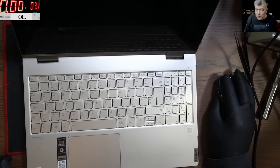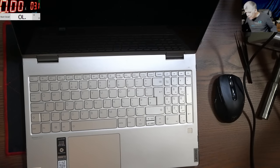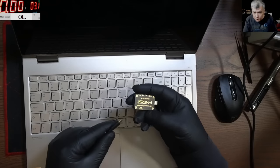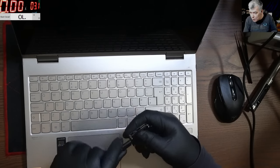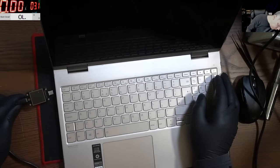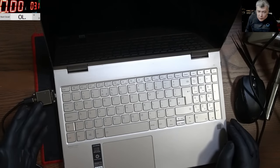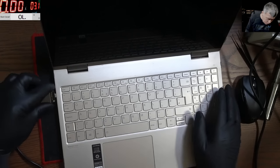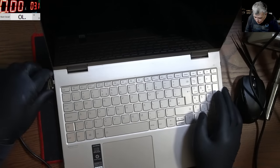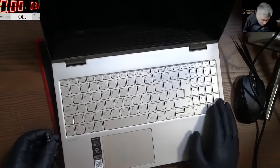It's been tested with a new charger and it doesn't charge on any USB port — the charging indicator doesn't light at all. Let me plug in the charger and the USB power meter, this little device which will tell us what's going on. We have two USB-C ports and there's nothing from either.